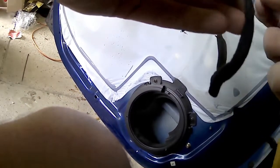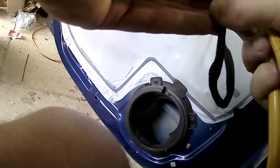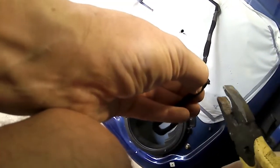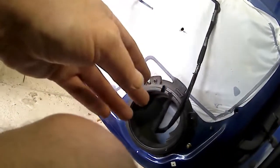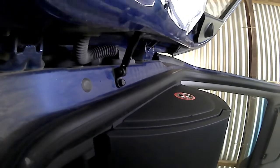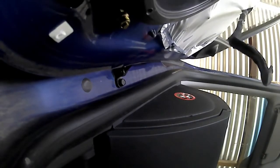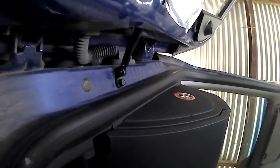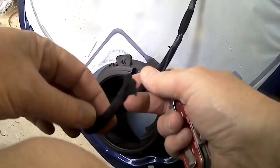So I'm going to slice it here in a minute, and then you'll see the two wires in there. Those two wires I'm going to join directly to the speaker wires. The speakers have their own little connection wire that comes with two spade terminals. In there you can see the umbilical cord between the door, that curly one there. That's got all the cables for the speaker and the power windows going through that little curly sort of conduit thing.